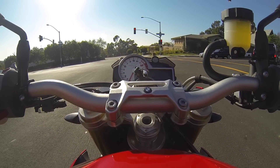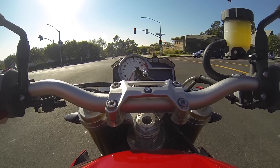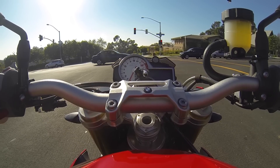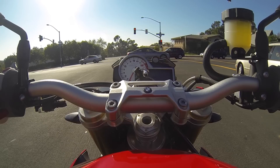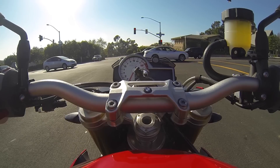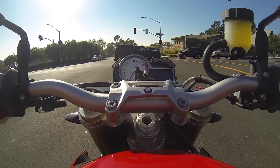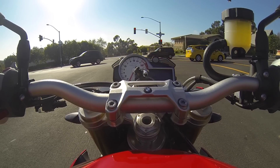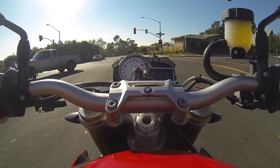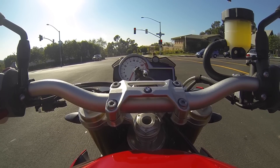Moving forward, the DDC with regards to brake diving — the DDC does a fantastic job of preventing the nose from having much dive, if any at all. Even under very hard braking, your front forks will move downward due to the forces, but it really does a nice job of keeping the bike level and planted. It's pretty confidence-inspiring for somebody jumping on this bike, maybe off a smaller CC, wanting something they can tour on.